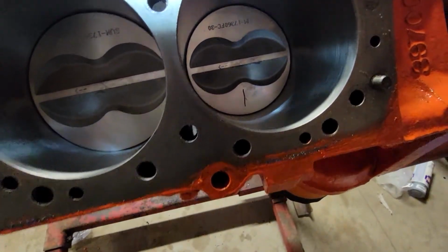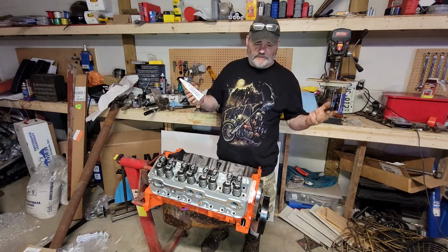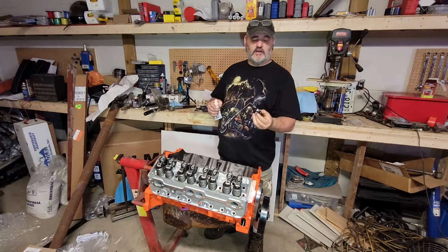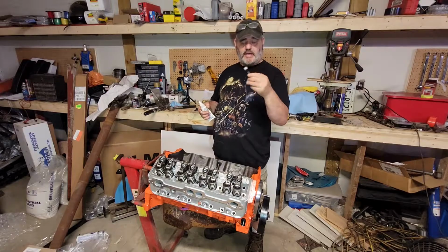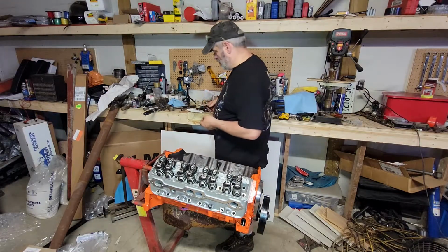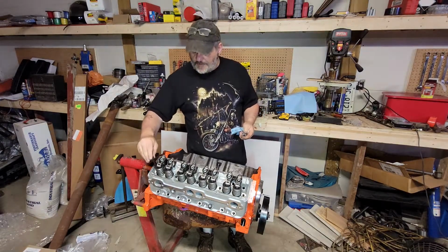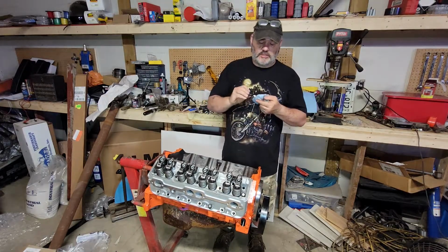You can see light down in there. I'm using the Permatex sealant here. You can use different kinds, just don't use Teflon tape. Okay, sealant on the threads and then lube on the washers between the bolt head and the washer. I'm gonna speed this up and just do a bunch here on the bench and get them ready. Intermediate bolts, medium, you only have 4 of them. They go down here in the ends. All your little shorties are on the outside.